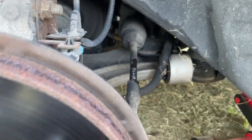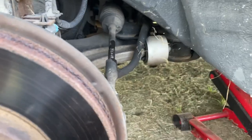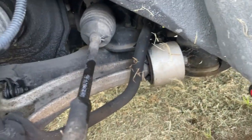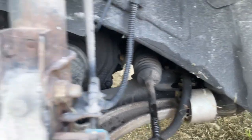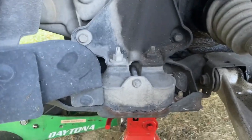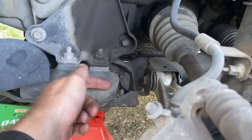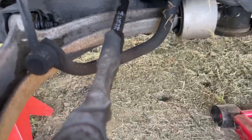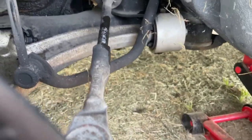All right, here's video two of our Malibu series — a 2004 Malibu. This will probably work on a lot of other cars too. On this one we're going to take the two bolts out of the back. We know from the passenger side we did yesterday that's going to be the appropriate course of action. This side we have to take the transmission mount out so we can get that bolt in the back, and then we've got our pinch bolt down the bottom.